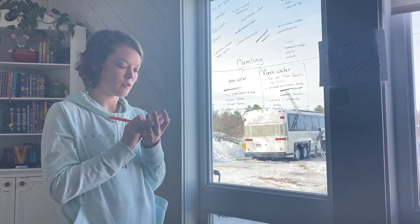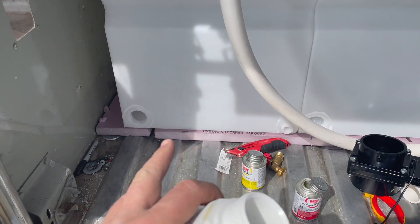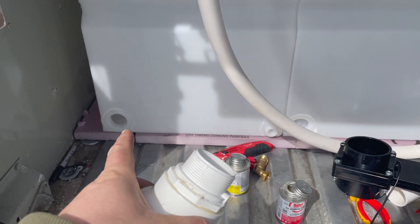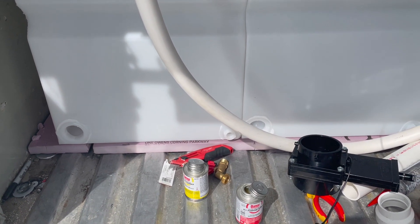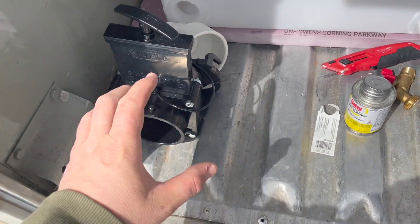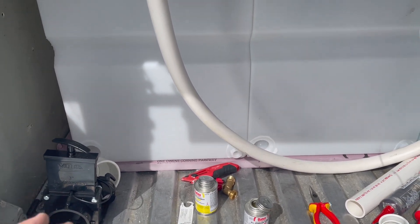Storage bay clean out. We're hooking up a gray tank — I'm trying to get my fitting, which is an inch-and-a-half fitting on the tanks, to one of my gate valves, which is about three-inch. I'll be able to put the fitting here and I'm going to drill a hole for any drippage. Ideally we want it out the bottom, but it's just too tight to get to fit.